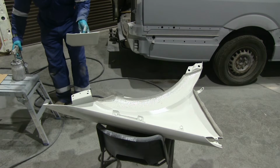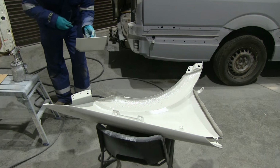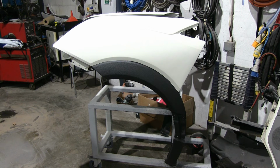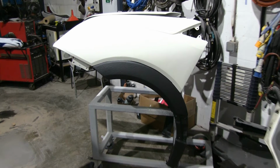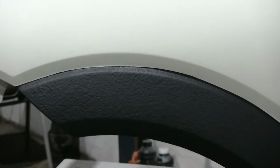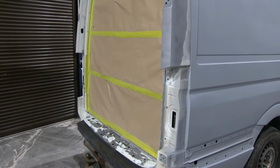Lots of small bits and pieces need to be painted and kept on the truck. Two different colors, as both of them are still the Gravitex anti-chip solution. It's just sprayed from different guns. The white color is sprayed from a 2mm nozzle spray gun, and the black part is sprayed from the actual gun that was supplied for applying Gravitex.